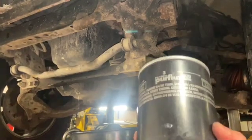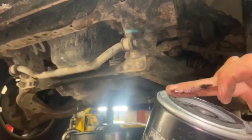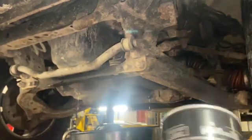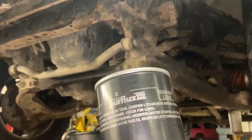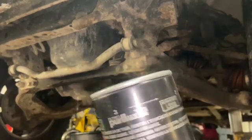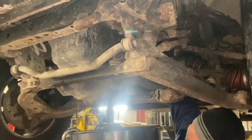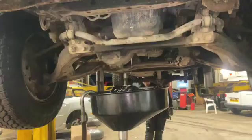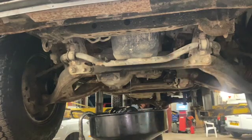While the oil's still draining, we've got the new filter. I'll put a link in the description below to the part number where you can get one from. Before fitting it, just get a little bit of oil and run it around the seal — just make sure it goes on nicely when you refit it. To tighten it up, just do it as tight as you can by hand — that's all. Note the direction arrow on it showing clockwise to nip it up. Once it's nipped up by hand, I'm going to give it a quick wash down with some brake cleaner — just nice and neat — so it's easy to check for any leaks when you run it up.